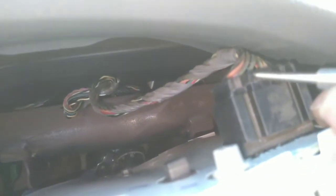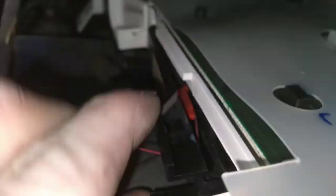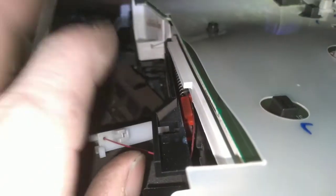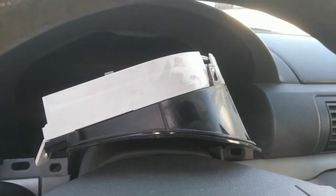Electrical connector at the top — should take a little flat blade. At the bottom, you have to remove the transmission range selector. It just pops right out. There's a little piece of nylon with a pin that holds it — you can hardly see it back in here. I'm not taking this all the way out, I just had to get to the wiring. But for those of you that do, you'll have to pry it out there, and then the whole cluster will come out. Installation is reverse of removal. Thanks for watching — don't forget to like and subscribe.